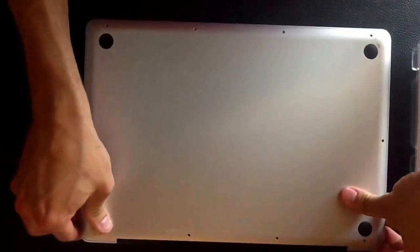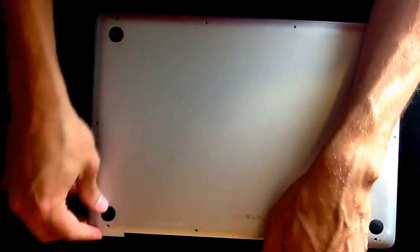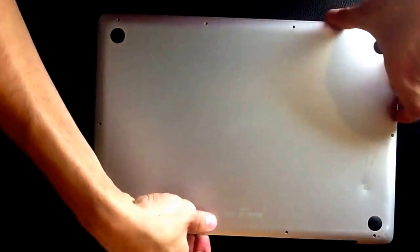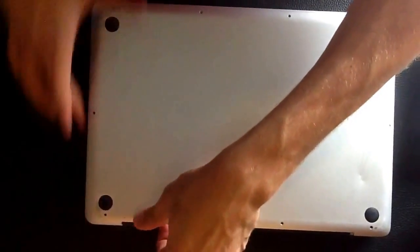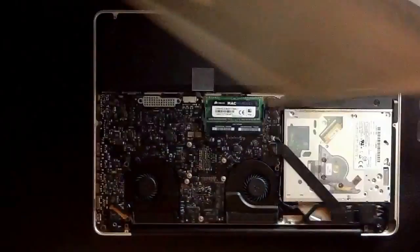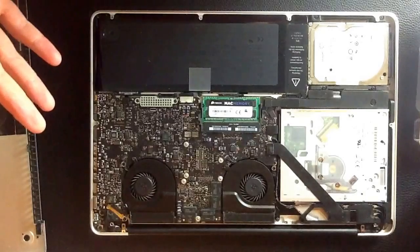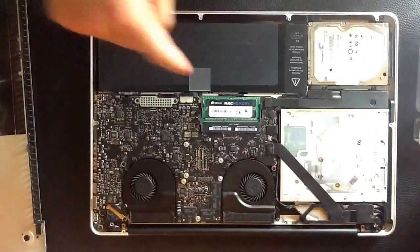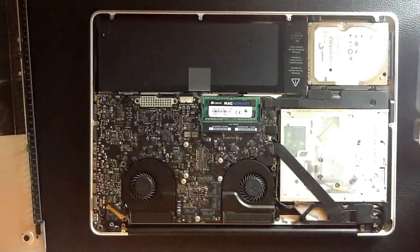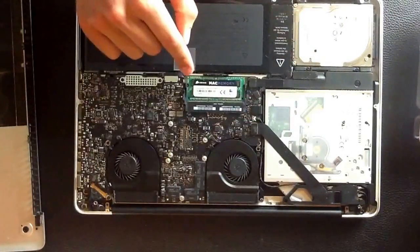Starting on the back end, you can see it's loose on the side that has the black hinge. I'm just going to slowly pick this up and work my way around. If it's not coming for whatever reason, you probably still have a screw in there — you missed a screw. Just ever so gently pry this out. Now of course this is where you want to be careful, because this is essentially your computer. We're just focusing on the Mac memory that you can see in the middle here.